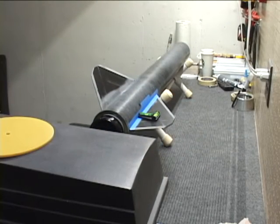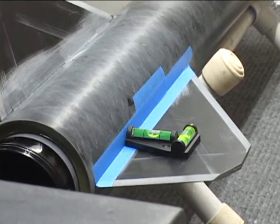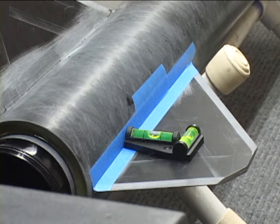Here's an internal injection that was just done. I injected it into one of those holes separated out between the length of the fin — about six inches from the front, six inches from the rear. I also put a level on there to make sure it's pooling level inside the tube, and just put a bunch of blue tape to seal the entire root length of the fin as well while it cures. Since this is West Systems Epoxy, I'll let this sit for at least eight hours before I move it.